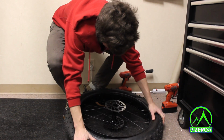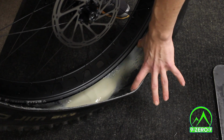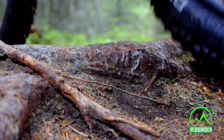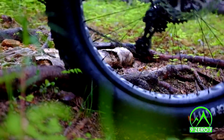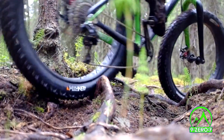If not, it may be time to remove one side of the tire and check to be sure there is still liquid sealant present. One of the advantages of a tubeless system is the ability to use lower pressures without pinch flatting. There will be a link in the description of this video with a recommended pressure chart to take full advantage of this. Please click the link for more information.